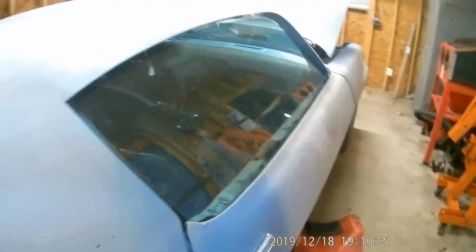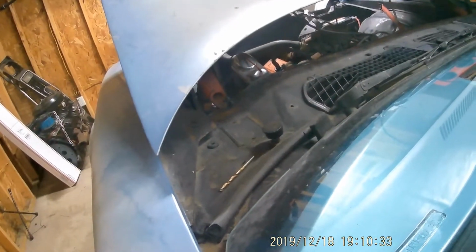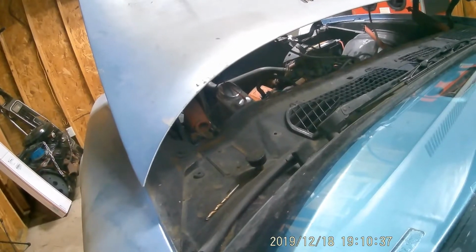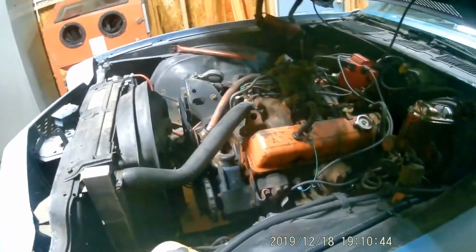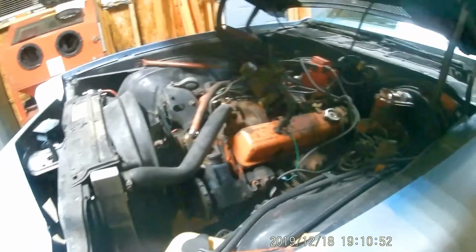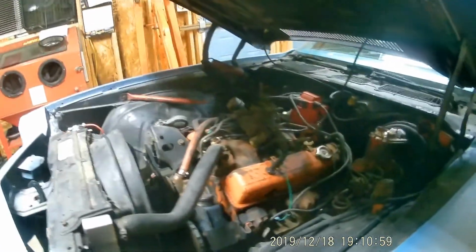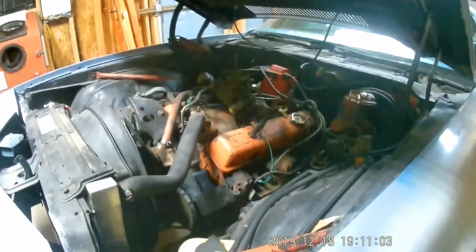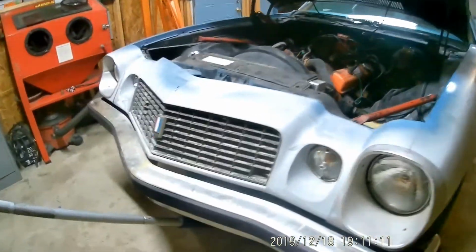But we do know if it turns over, it has a bad connection at the starter. So that tells you something. One of those wires where they crimp the connectors on, it's loose, probably in the main solenoid wire, the little small wire. So what I'm gonna do, I'm gonna go up under there and take them off, clean them, check them, make sure they ain't broken inside those connectors, and put another end on that small wire for the solenoid, and then we ought to be able to snatch the plugs out and perform a compression test. So let me get that going on.